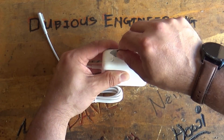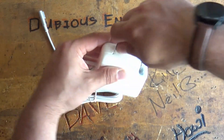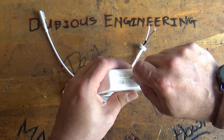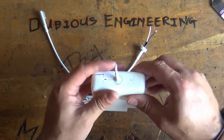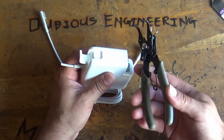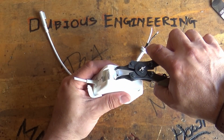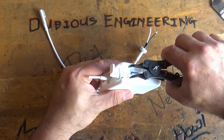If you get in here and run down the sides, then put a little bit of stress on those sides by applying a rotational force, you can hear things start to crack open ever so slightly. You've got to do that all the way around the device. Once things are sort of open, these are a pair of inverse pliers — rather than squeezing things when you close the handles, they open things when you close the handles. You can pop those in and carefully lever the sides open.